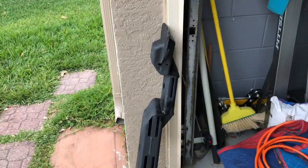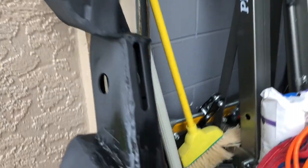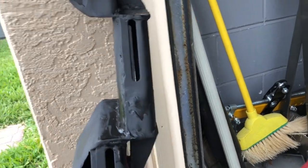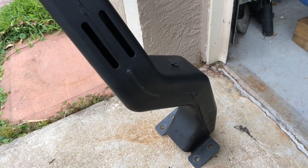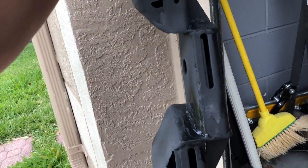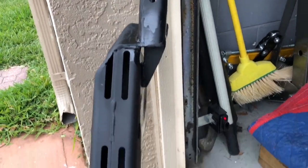After a bunch of welding, a lot of grinding to cover up my crappy welds, and welding in a couple of gussets on the top here, this is what I've come up with. It doesn't give me quite as much clearance as the other side for exhaust - I think I've got four and a half inches there, and I think I have three inches on this side. But unless you're running more than like a three-inch exhaust, you should be able to fit that through there and still have it be above the frame rail line so you're not scraping your exhaust on stuff. This was my solution.